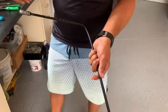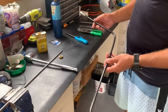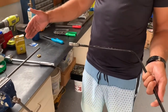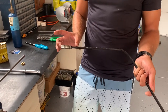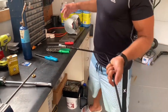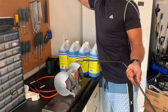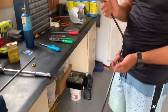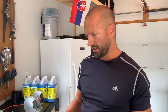You can see the two bends are relatively parallel, so they lined up nicely. Because I had such a long bar, once I measured exactly where I needed it to line up on the kicker motor and where the ball joint was going to be attached, I was able to cut it off with a hacksaw. Any hacksaw will do — I have a simple cheap one — put it in the bench vise and sawed right through it. Then I ground down the end, put a thread in the other side, and assembled everything together.